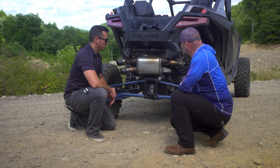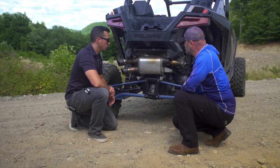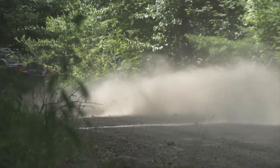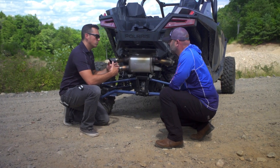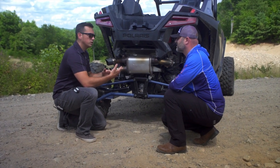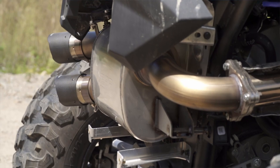That's a unique way of doing it — similar to what we do on the automotive side. We really want to make sure we get that perfect balance between sound and flow, and ultimately performance. When we test this, our big thing is you don't actually need a fuel tune or anything to run it. When we measure on the dyno, we're measuring air-fuel ratios, so it's not going to run into a lean condition even though we are giving it maximum flow.